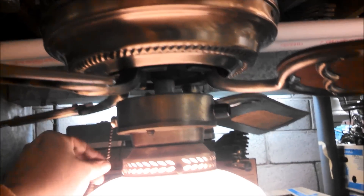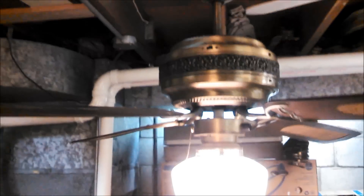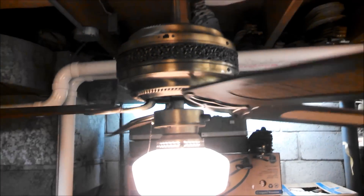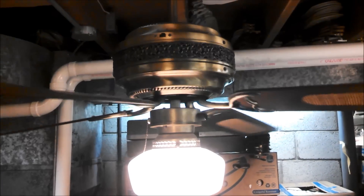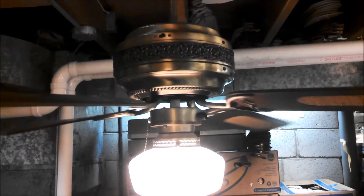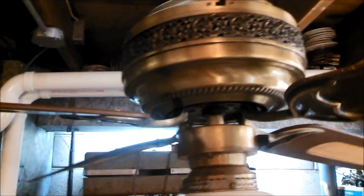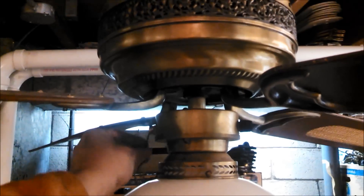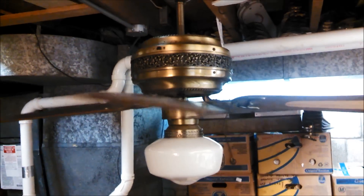So the sequence is: off, fan, light, then light and fan — at least that's what we're supposed to have. In the previous video we confirmed that the capacitor was good; it was giving symptoms of a bad capacitor but that's in part because it was disconnected. With the light and fan, that's 0.31 amps — that should be both off. Then fan only is 0.2. It's actually very quiet for a metal flywheel fan with no rubber.